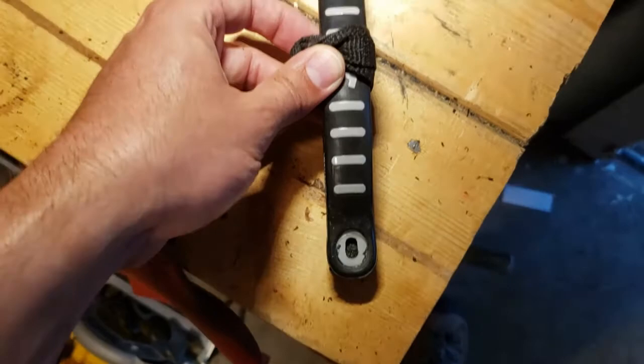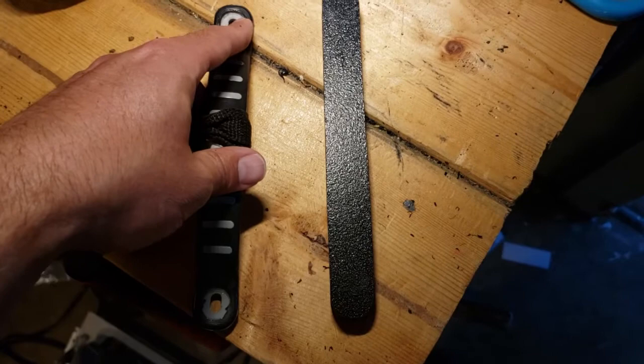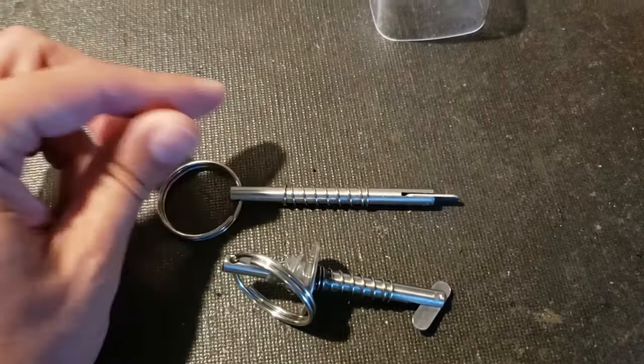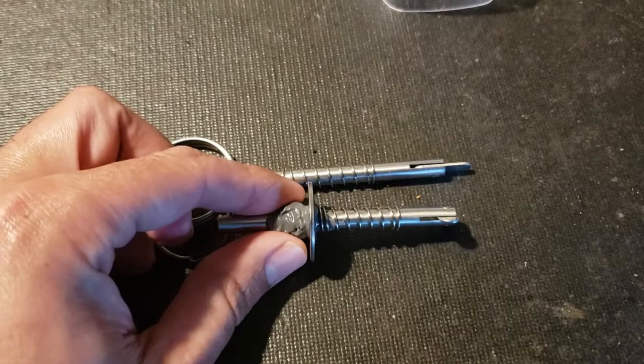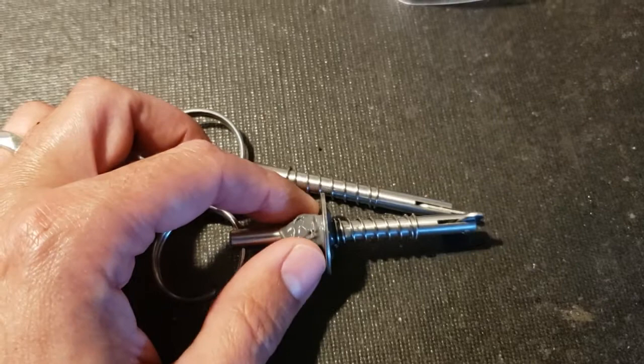What I'll do is drill two quarter-inch holes here. That'll be where I run my screws through, just like you would on the handle, to mount to the molded-in quarter-20 inserts on Jackson kayaks. I've taken a hitch pin type system — all stainless steel marine grade — and modified it. First I wrapped some copper wire, which you can see right here, making a tight wrap around the shaft. Then I JB welded that in place and also put a quarter-inch inner diameter washer on there. I used the wire to add a little extra surface area for the JB Weld to grip onto.